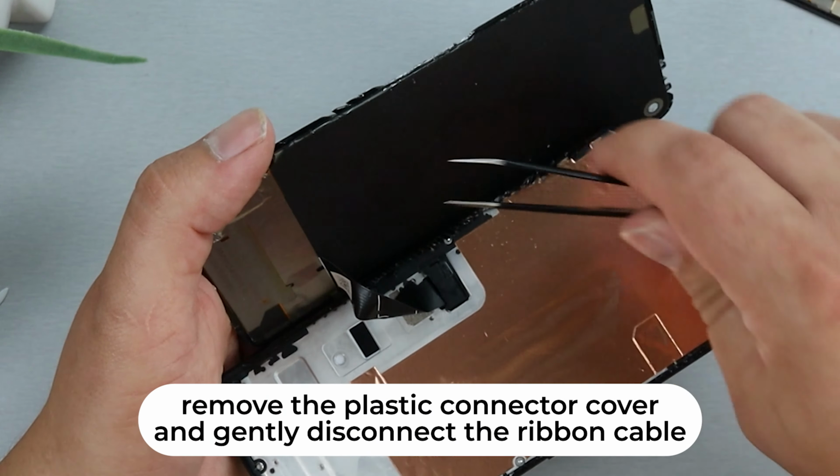Hey guys, here's the mistake I was talking about at the beginning of the video. Hopefully you skipped forward to watch this. As you can see, I forgot to remove the blue protective plastic from behind the OLED panel. This film will prevent any adhesion between the OLED and the adhesive. Fixing this will be pretty tricky since I've already begun attaching the screen.